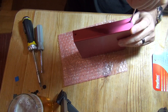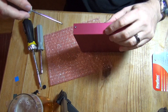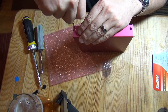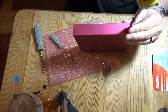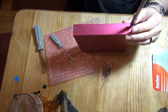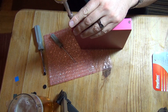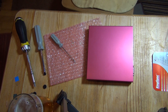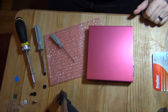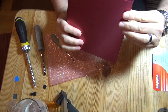This is a very low power unit, which is an advantage. In the long run, the running costs will pay me back because a PC is going to consume probably at least 10 times the power. This is 6 to 12 watts in operation — 12 watts is the maximum, which is fantastic. It's completely passive, as you've seen in the build — totally silent. In operation it is slightly warm to the touch, with CPU temperatures at around 52 to 53 degrees C, and I've not seen them budge from that.